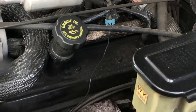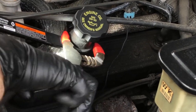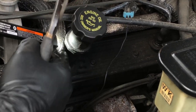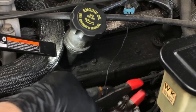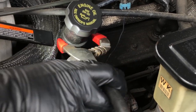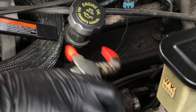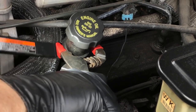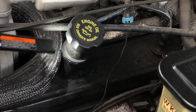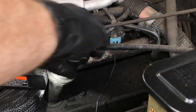So in this case it's a simple fix. I'm just going to take a wrench in here and we're just going to tighten this assembly up. There are some little flats you can see right along the edges here — it allows you to get a wrench in. I'm using one with some plastic head tips just so I don't mar it, because it is plastic. You just want it snugged up, and at that point you should be able to remove the filler cap without the whole pipe moving on you.